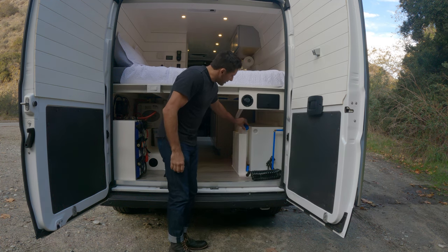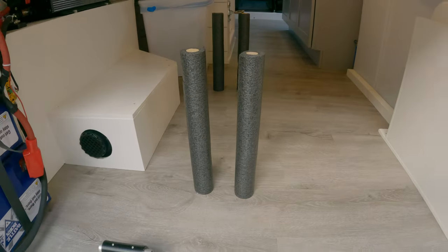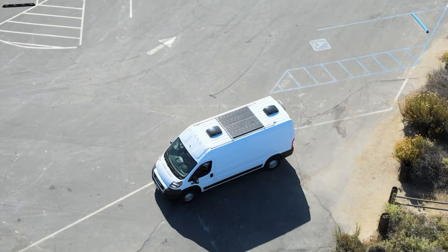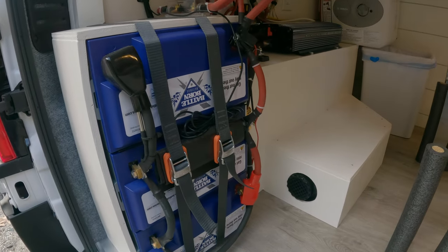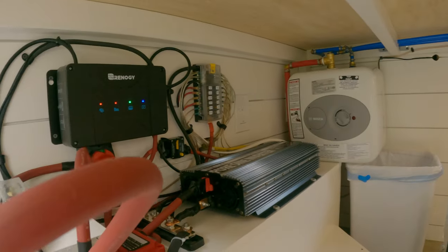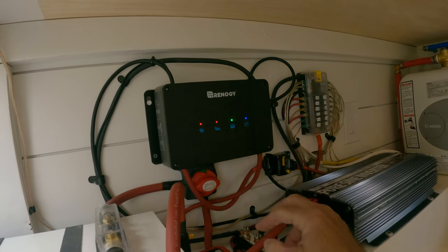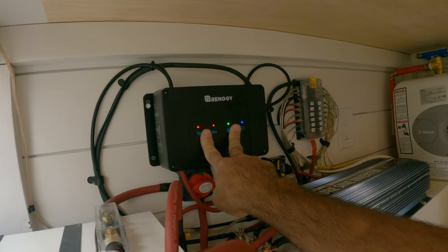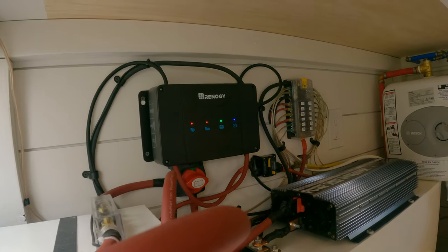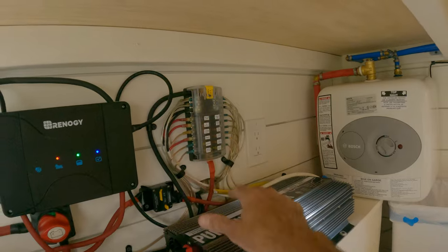This is the tank for the diesel heater — it's a seven liter tank. The actual diesel heater is back here, boxed in. I ran the pump under the van so it's a little more quiet at night when you're sleeping. For power, I have 400 watts of solar panels on the roof and 300 amp hours of Battle Born lithium batteries — these are my favorite batteries, I think they're the best you can get. Here's all the electrical equipment: I've got the 50 amp DC to DC Renogy charge controller, which also allows for alternator charging. So you can charge off the solar panels, which is usually more than enough, but if it's raining or cloudy the alternator charges as well. I've got a 2000 watt pure sine wave inverter and a DC sub panel and fuses.